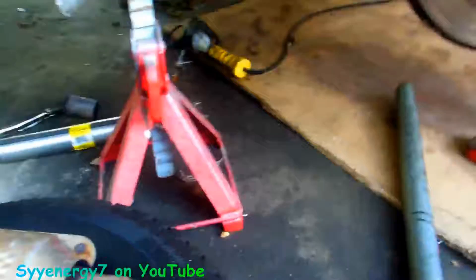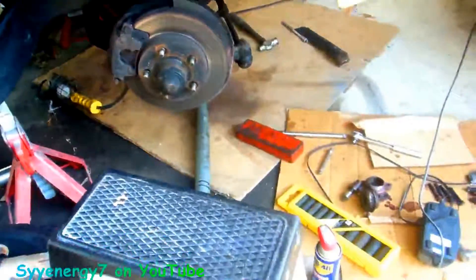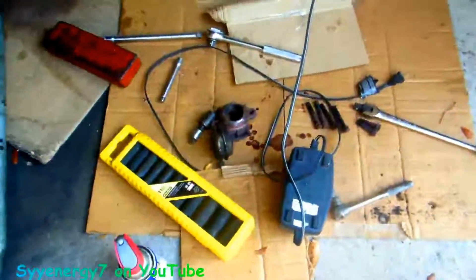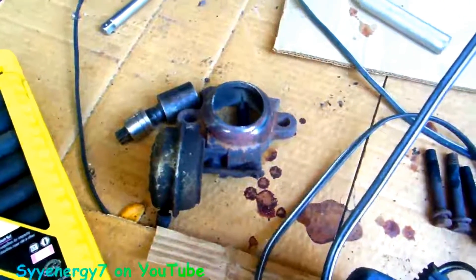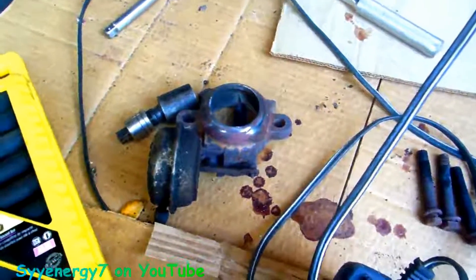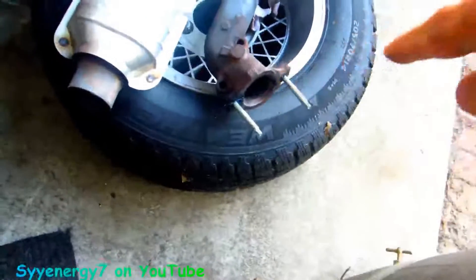The engine is actually the last thing you do. I got the bypass for this thing — it was a three-hole bypass, but it's not the right one. I don't even know where to find the two-hole heat riser — three holes is usually what they are, that's what I always saw on Chevys. I filed this down here smooth so the bolt goes right here and the other bolt goes right there. Got the gasket for it and the heat riser gasket.